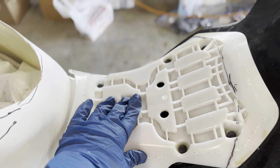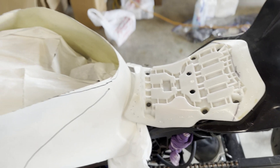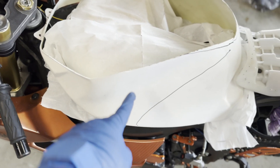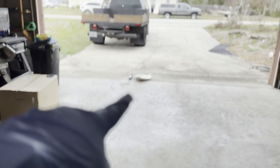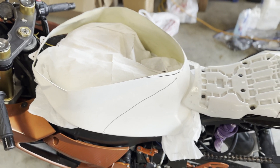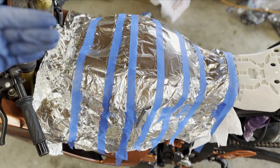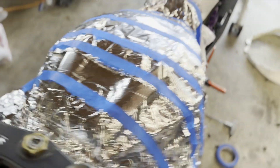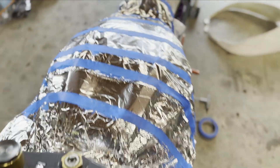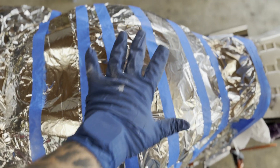On the back here you can see we have this hard mounted, and we're going to build this up a little bit to make a bump stop mount so they can't slide back. I'm actually going to take it off again, trim a little bit more, and keep that top part and basically fit it on here and scale the tank down a little bit. So we have the center piece — the piece that we cut out of the fiberglass tank cover — it's down here, taped and angled the way I want it. It's hard to see because I have the foil already on it, but it is perfectly straight. I have that fiberglass cover underneath this foil so it doesn't stick and try to move my cover, and I have this all hard mounted.